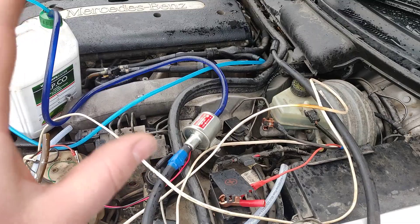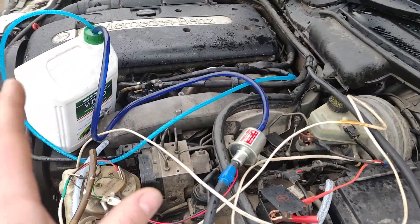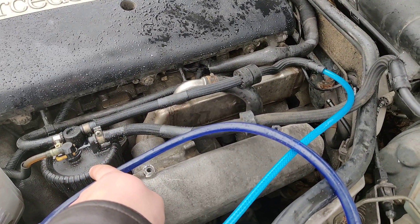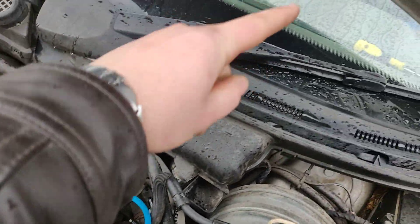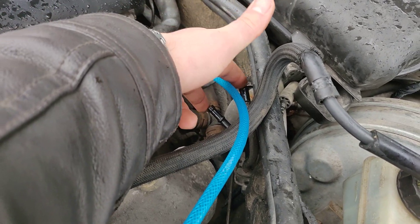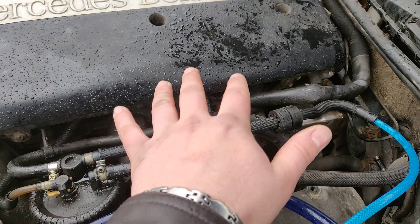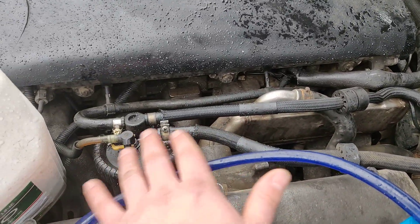Now we start up the car and it's running good. The problem was the car was not able to start at all — you could crank the engine as much as you want, no chance of starting, because the fuel from the tank was not getting into the filter. The electric pump at the back of the car was dead, and if there's no electric pump on the back of the tank, the problem could also be in the suction system.